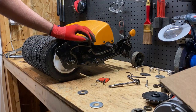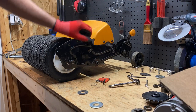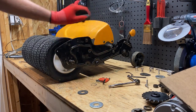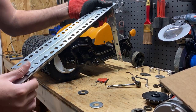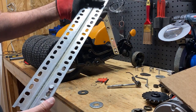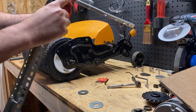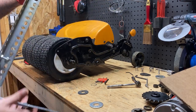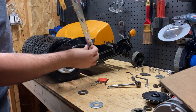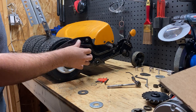I've put back practically all the screws in place. I left two open because that's where I connect the bracket that holds the motor. This is the bracket I use to mount the motor onto the Fiskars mower — just a regular bracket you can get at any big box store like Home Depot. To attach it to the motor, I used some L-brackets combined with a straight bracket, drilling new holes to align with the two existing ones on the Fiskars mower, so I wouldn't have to make major modifications to the mower's structure.